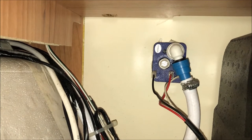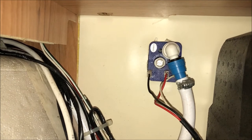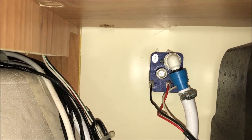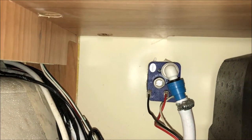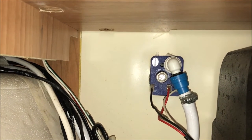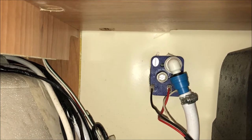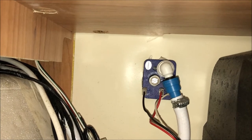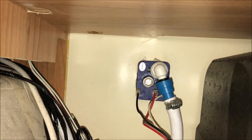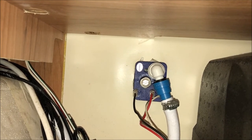My plan is to have this door shut, lay down there and try to get into the bottom. As you can see there's the inlet where the water comes into the caravan. Almost in the centre there's a little screw with a lock nut. Make sure you've got water in your heater and water coming into the van - we're on the service pitch so no worries. Undo the lock nut and tighten the screw up until the pump comes on. Once the pump comes on, open a tap and make sure you get a decent flow of water coming through. Then close the tap and turn the screw anti-clockwise until the pump stops. Give it another half a turn and then close the lock nut.